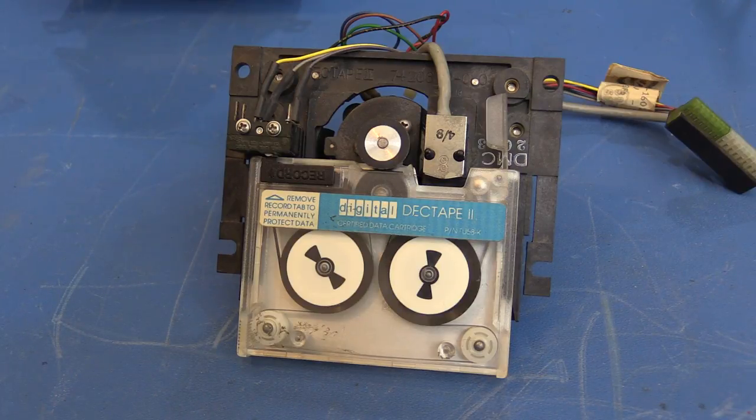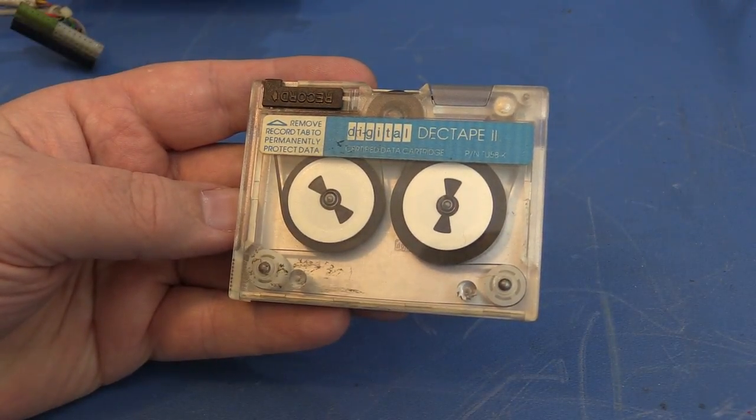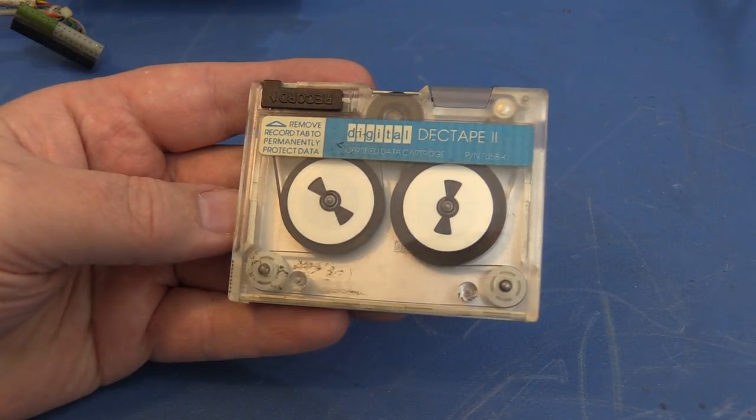While they were a lot slower than floppy drives, they were cheaper and very easy to interface to small computers over an ordinary asynchronous serial port. This is a TU-58 cartridge. It stored 256 kilobytes, using two tracks on 0.15-inch wide tape media,